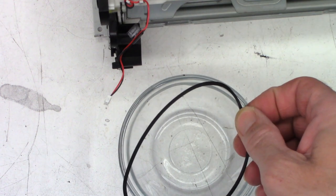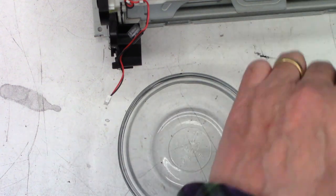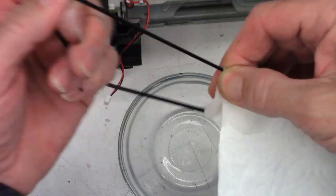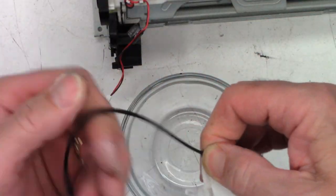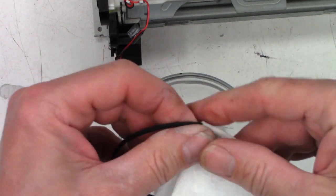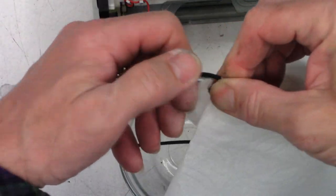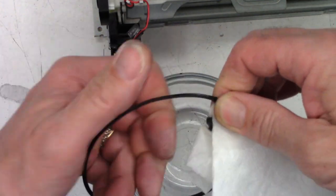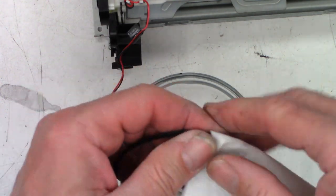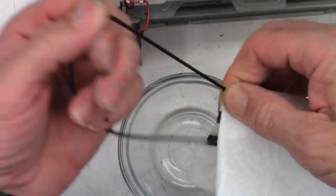I know you can't see it, but I'll go ahead and pull the used belt off. Absorb some acetone into it, and then just go ahead and wipe the contaminants off the belt. People tell me that this is going to shorten the belt life. Well, the belt's already 2 decades old. And I've had extremely good luck doing this with belts to remove the contaminants over time. I think it actually makes the belt last a little bit longer.